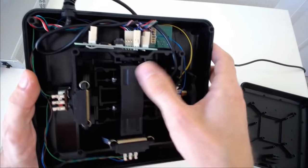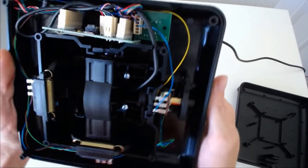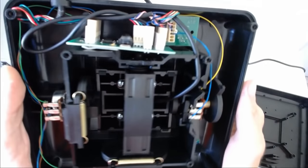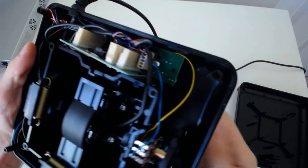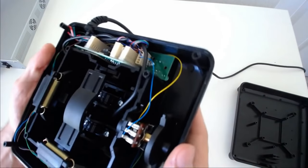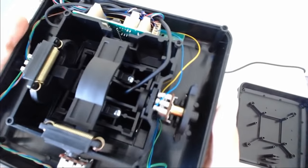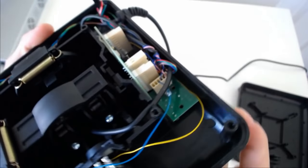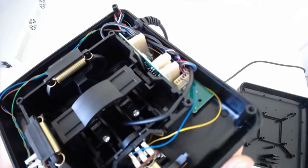It's the same tough industrial plastic. It's what's used to make the gimbal. You can see four screws in there we could use to detach the base completely. The thing that I think this could really use is some grease, like a good damping grease on this gimbal, might really help that detent effect when you cross center.